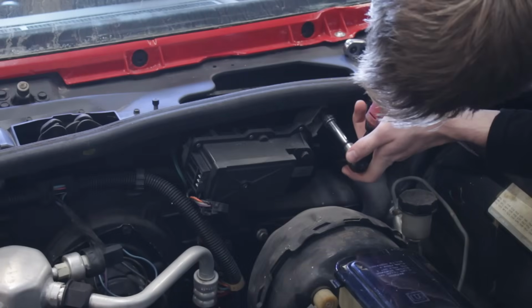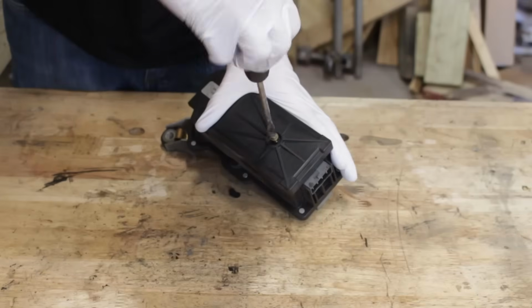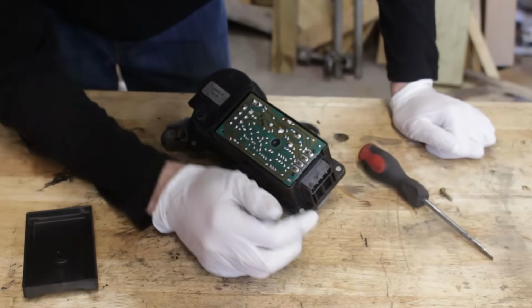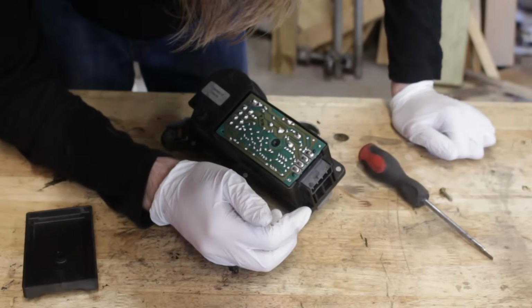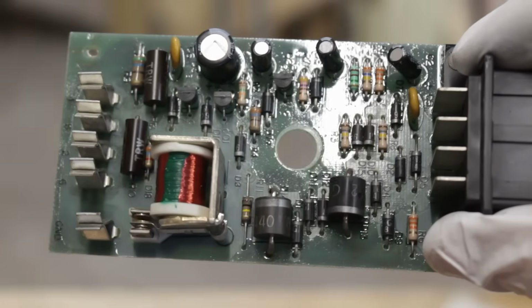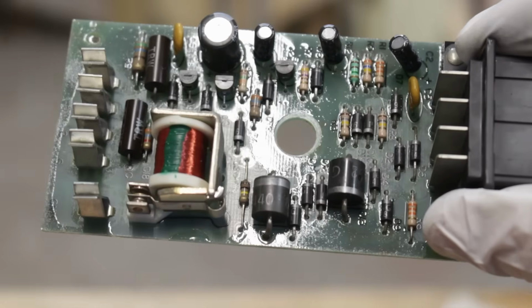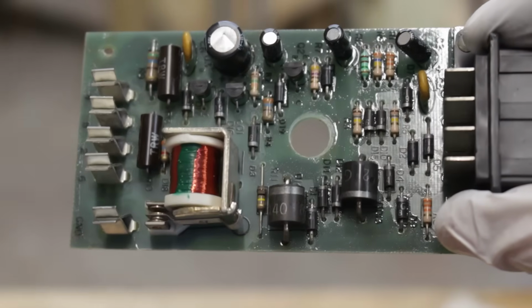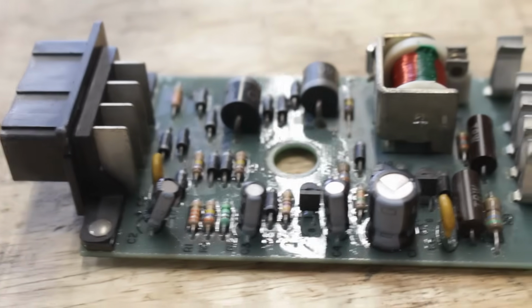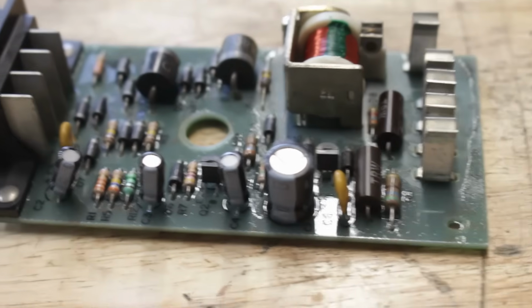But when going to take the cover off for this control board, I noticed that the screw wasn't secured all the way. Someone's been in here before. That's a circuit board. And more than that, this is not a factory board. A bit of Googling will show you that the factory board has a big fat Delco logo right in the corner, so that's kind of a red flag. Not the replacement board itself, but the fact that a board was replaced, more than likely in an attempt to fix the phantom wipe, and the problem still persists.